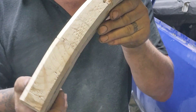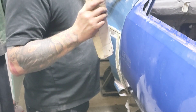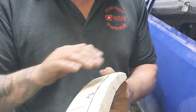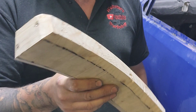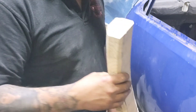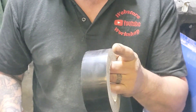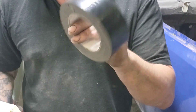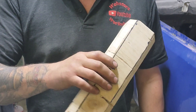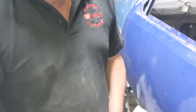This back bit here will be the mesh for the wing, so that's a fair size vent as you can see. Before we get on with the fiberglass, I could really be body working this, filling it, painting it, making it absolutely smooth and mint, but for something I'm going to use once and then throw away there's no real point. I've made it double-sided so I can flip it around for the other side. For now I'm just going to cover it in duct tape to make it a bit easier to release it from the resin once it's set.